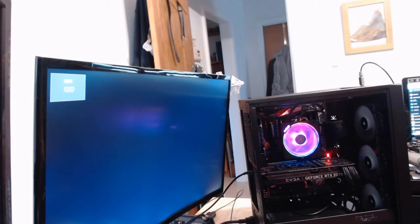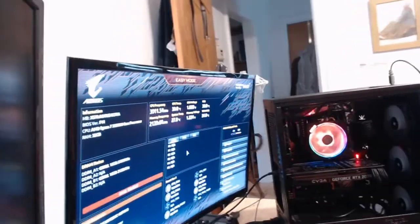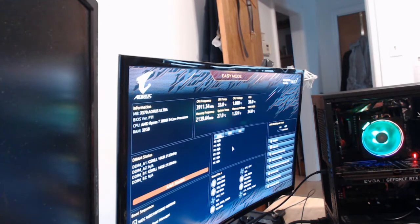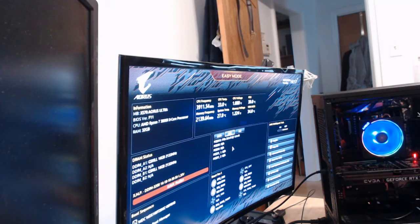Okay. If you want me to overclock your RAM, I can definitely overclock your RAM. Hey, look, your fans are spinning. You guys see that? That means it works. All we have to do now is put Windows on. Well, I gave you the default one. It's going to run at the 3200. XMP, right? Yes, okay. Profile one. Because that's off initially, right? Yes.